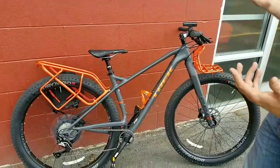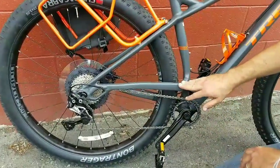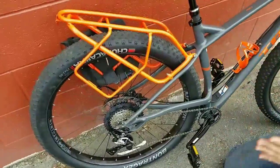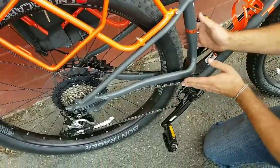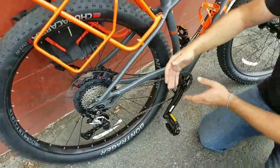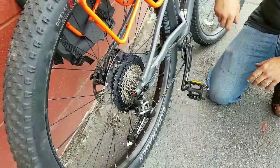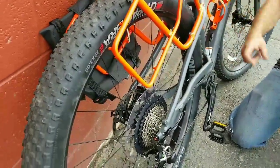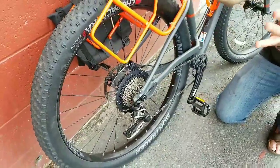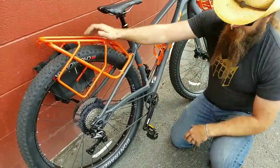A couple of key features make this bike really unique. With these big wide tires, in order to keep a nice chain line, they elevate the rear chain stays above the chain line. This allows you to keep a nice tight Q factor — that's how wide your pedals are — which affects pedaling performance and hip alignment. We've got boost spacing on this, a wider spacing on the rear end that gets the wide tire in there and creates a really strong spoke angle, so you won't get any flex on the wheels. They're also using a 50 millimeter wide rim, which gives a nice square profile on the tire. A narrower rim would give a balloon-shaped tire that could roll over at low pressures during hard cornering. The wide rim keeps a square profile and lets you take full advantage of those low pressures.